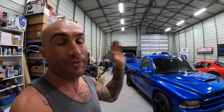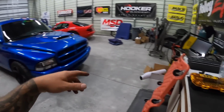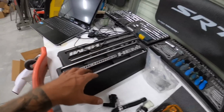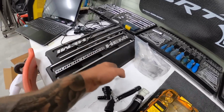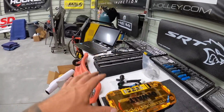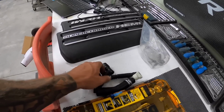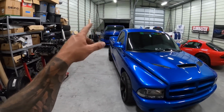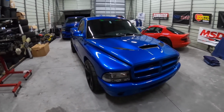Okay guys, so that's gonna wrap it up for this video. So we've got some stuff to contend with. Still nothing too crazy, but on the Ram, I still have to fit these covers on, or at least I want to. So I gotta get those all ready to go. The one should just be a plug and play situation. The other one I'm gonna have to cut a little bit around the brake booster to clearance it, but I think it'll look cool having those on. Other thing I got to do too is I've got some catch cans in the box over there, so I'm gonna have to use a combination of the factory fittings, and then a catch can is gonna go on. So we're gonna make it for sure for the Ram, and then hopefully I'll be able to make one for this as well, as long as time permits.